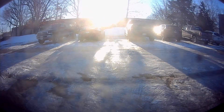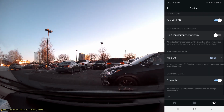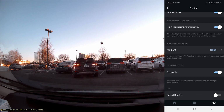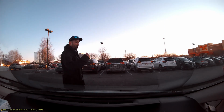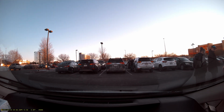Of course, this parking mode does have low battery protection, and during the winter it can be set to cut power to your battery even sooner, because you don't want to drain your battery too low on a very cold winter day. If it cuts off at a point that it would normally cut off during the summer or warm months, that cold temperature might drop your battery voltage overnight even more and leave you with a dead battery. So that winter protection feature is nice.